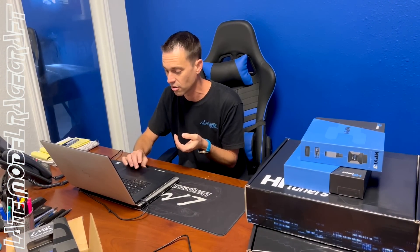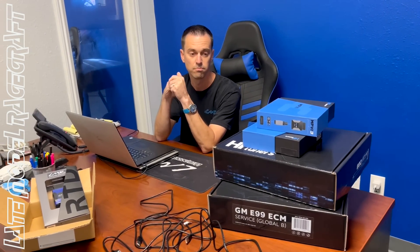The scanner already has a lot more things for me to data log than in the past. I want to show the world out there the process of doing this — you don't just drop your new Corvette off like the old days and wait while it gets tuned. You have to bring your car in, we have to put the car on the rack, pull the ECM out. And depending on what year your ECM is, it's in different spots in the car.